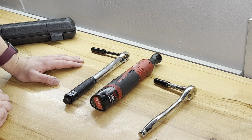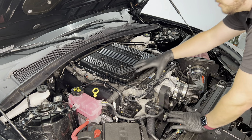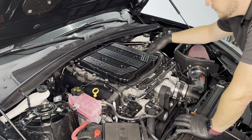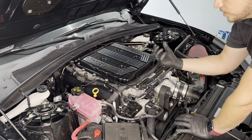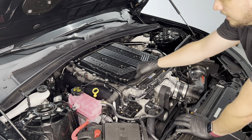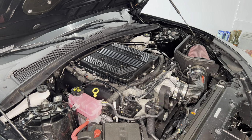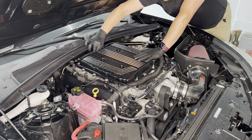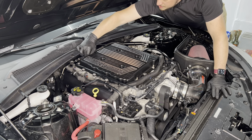This process is pretty easy. There are 20 10mm bolts that hold the lid on, including the four that are in the center. There are some wire harnesses that are attached to some longer 10mm stud bolts, so you will need a deep well 10mm socket for those — they just pull off. There are two in the front, then you have another harness in the back that also attaches to those longer studs.